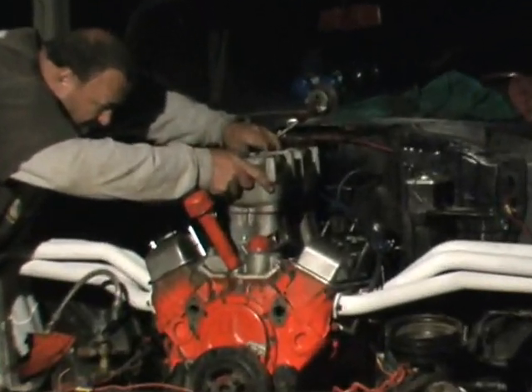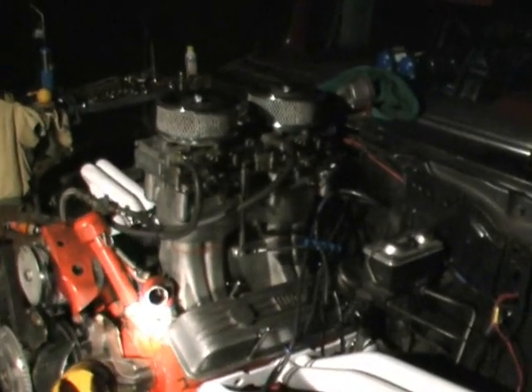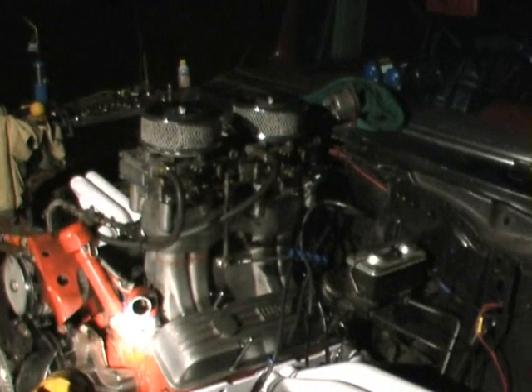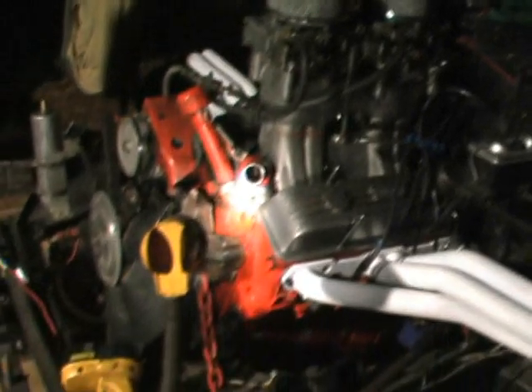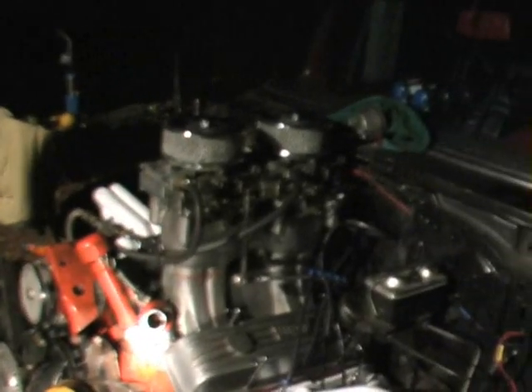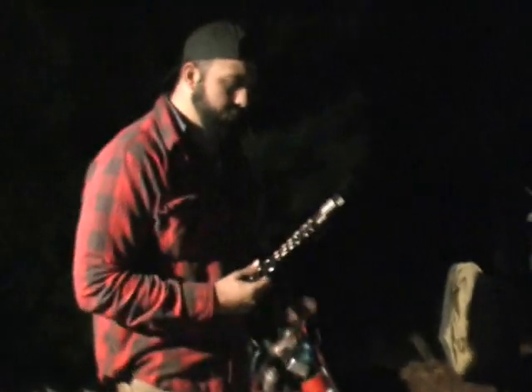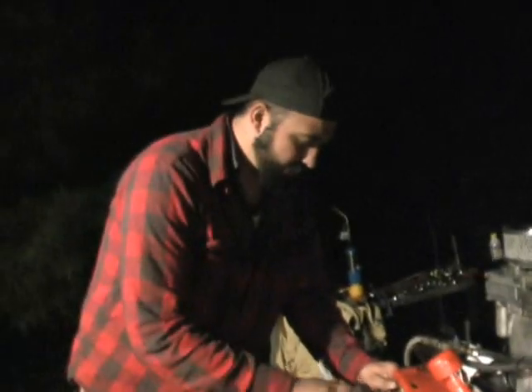Top of the intake is going on. Late night oil still burning - Skull Garage late night, whatever it takes. Got the carbs back on it, intake all sealed up. Plug wires are on it, all the headers up, water pump is on it. Tie-down chains on it, motor mounts are tight. All the headers are going on, then the radiator and the shroud. We might try a fire - do some fiddle-farting around. I can't start tonight, it's dark.